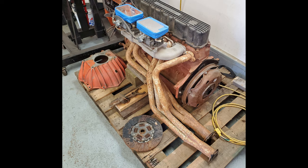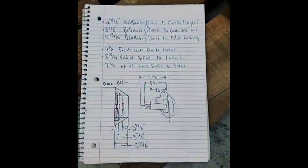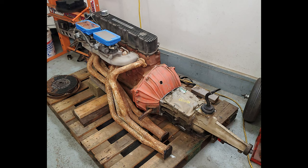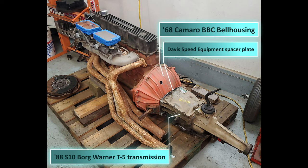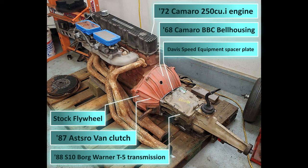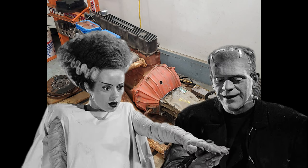Next up, I had to figure out how to connect the transmission to the engine. In my weeks of research I think I had it figured out, but the internet is a weird place — there's too much information out there, and new pieces of information kept making me doubt what I thought I knew. In the end, I was able to use the bell housing that came with the engine — a 1968 Camaro big block bell housing — and mated the 1988 S10 T5 to it with a Davis Speed Equipment spacer plate. The flywheel is native to the engine, which is actually a 1972 Camaro engine from an AC car, and I used a 1987 Astro Van clutch disc and pressure plate to complete the Frankenstein setup. Yeah, things got weird and complicated, and I can't believe I figured it all out. I'm also sure there's about a dozen other ways to piece it all together.